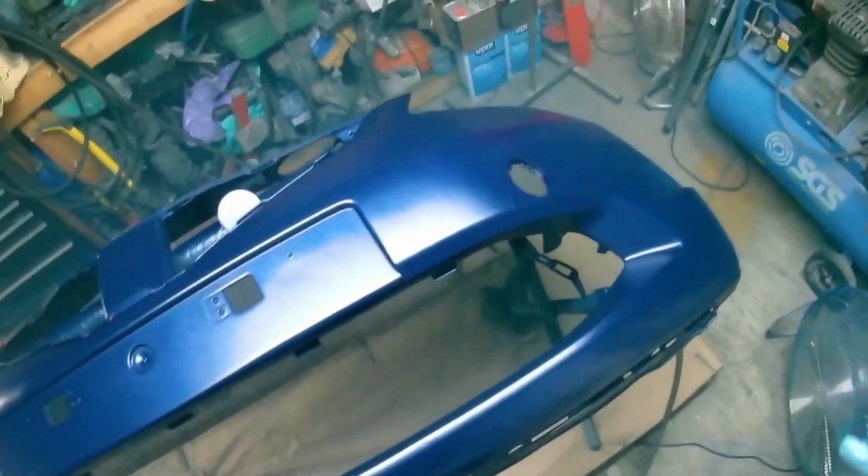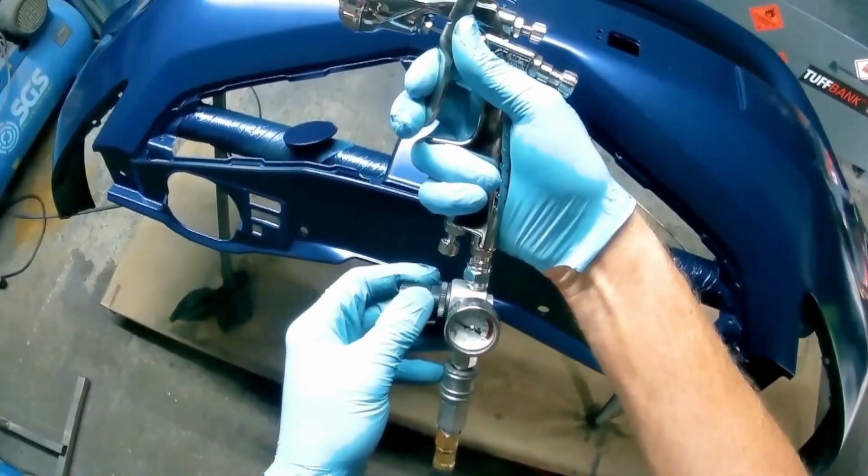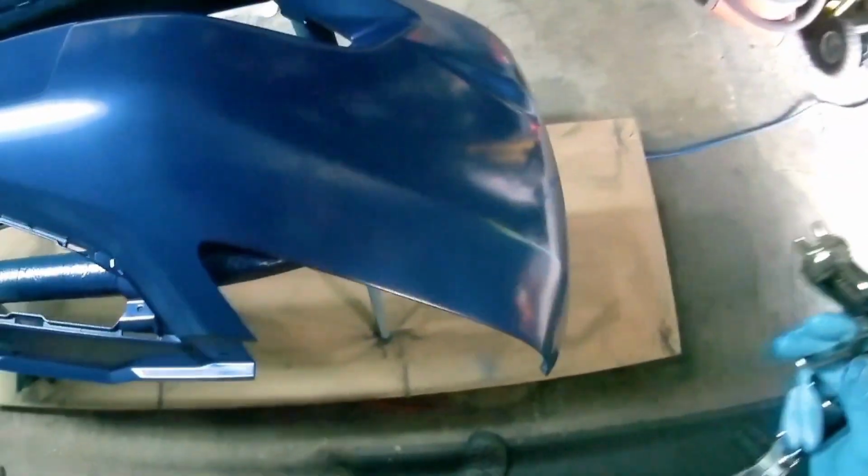So it's quite beneficial for it to be as warm as you can get it. But one of the things I was going to say is, if you're using a heat gun on metallic paint, be careful, because you need to let that paint dry a certain amount before you go on with your heat gun. I try and get it nice and close, to save as much energy as I can, and get as much heat as quickly as I can into whatever I'm doing.